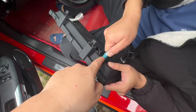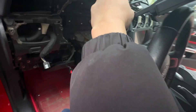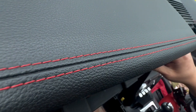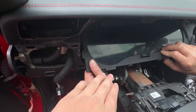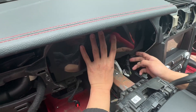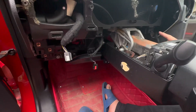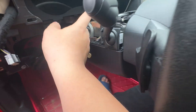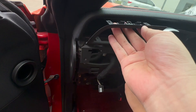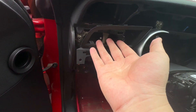Let's go to install this unit. We plug in the USB adapter. This is your cluster — it's pretty easy. Use the factory main plug. This is going to be a huge 15-inch screen. We plug the factory main plug to the head unit. We only need two screws right here. Also, remember your factory fans need to plug in and connect here.